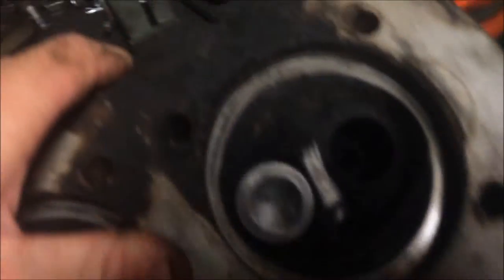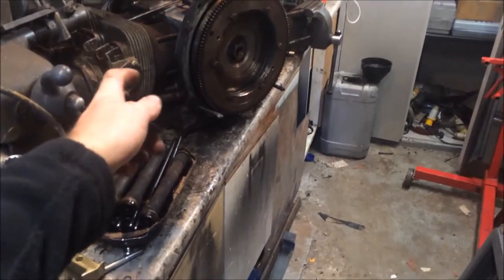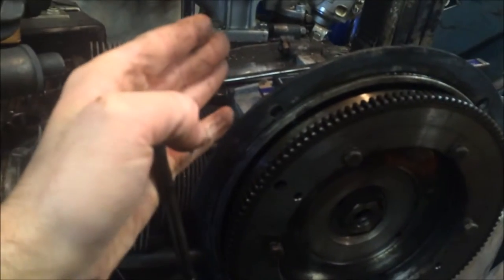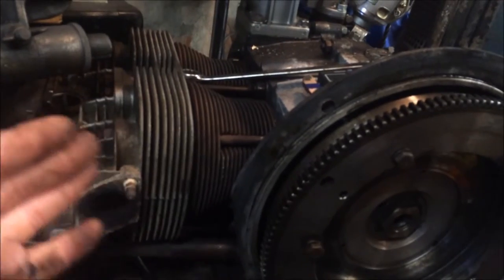The guides are elongated, so it might want new guides in the heads. That one might be alright because when you put your hand over the exhaust - on these the exhaust is basically out of the heat exchanger on the back and then goes to the silencer with one tip on each side - you put your hand over three and four and it feels low, put your hand over one and two and it feels okay. So that might be a bad head wanting new guides.